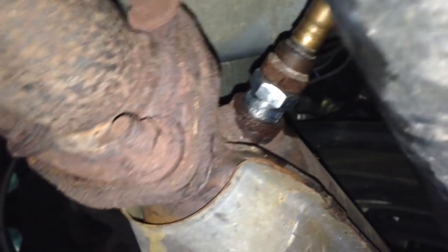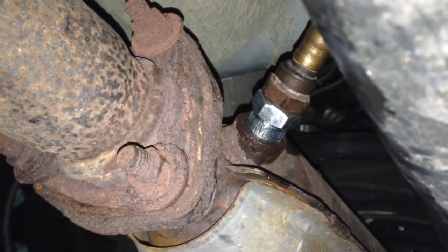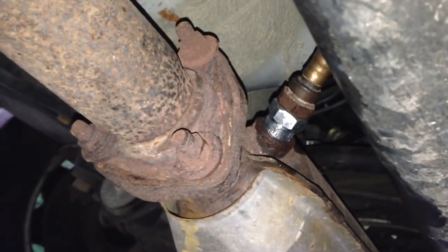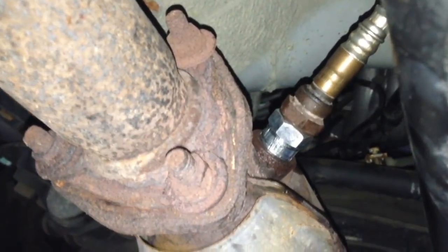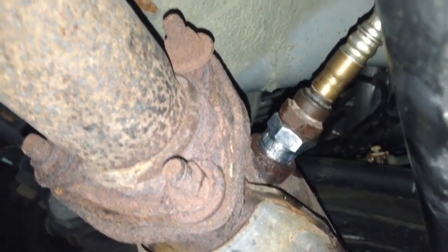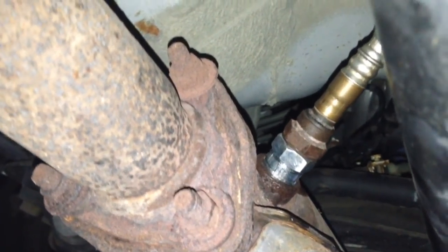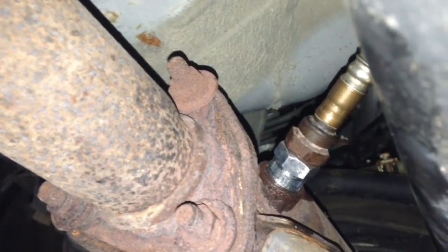Something you need to remember: all non-German cars you're going to have to drill the center of that spacer out. All German cars you do not. And if you don't want to unhook the wire because it's hard to get to, you can just swivel the O2 sensor — count the turns when you take it off without unplugging it, then wind it in reverse before you reinstall it so you don't twist the wire.